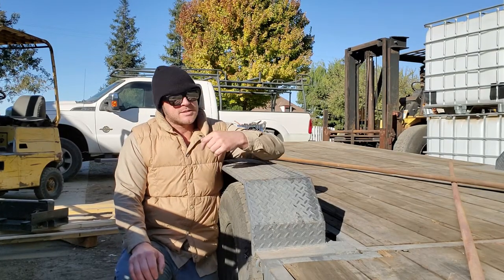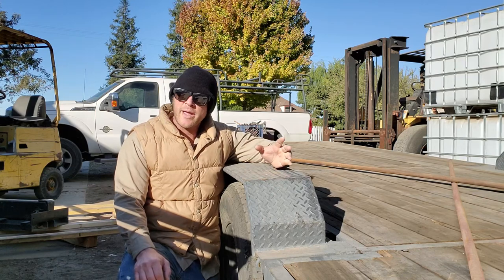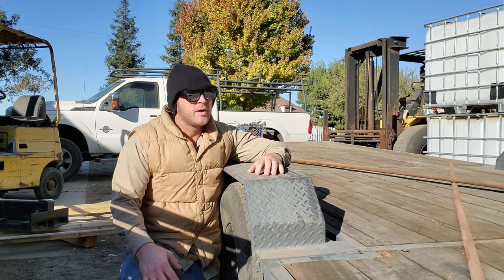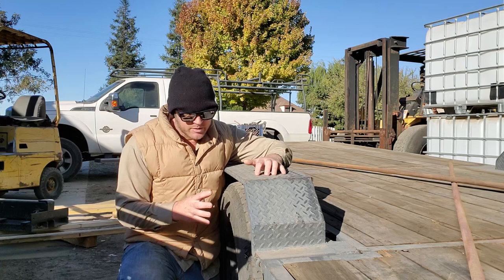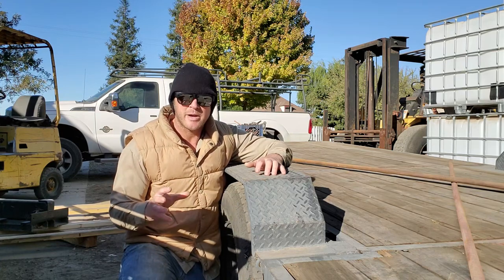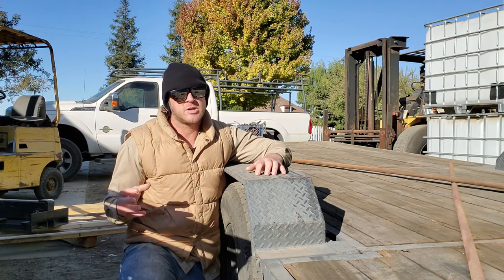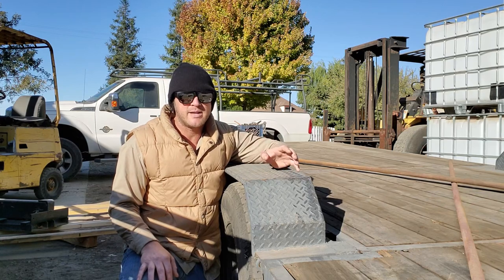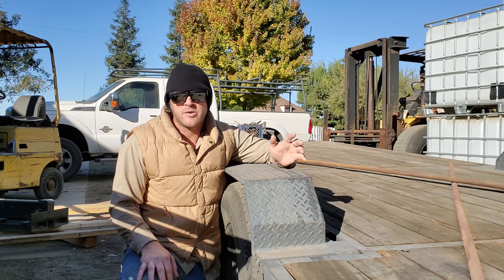Okay, let's go ahead and summarize this project. So, how I ended up with a fender trailer as opposed to a deck over. I mentioned in the first video that I was talking to a friend of mine who knows a lot more about tire and wheel combinations than I do. My original plan was to run low pros on this. He discouraged that. He said they wear out quicker. If you ever have any trouble on the road and you have to buy a tire somewheres where you've broken down, he said you're not gonna find one.